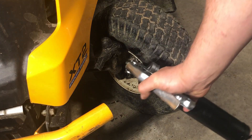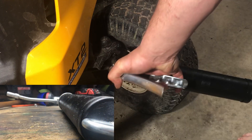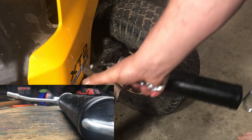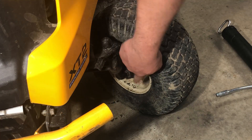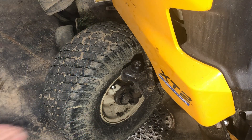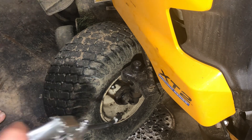You can really see how the slight bend in the grease gun tube makes it possible to get into hard-to-reach places to hit those zerks. Just keep pumping until grease comes out somewhere and you are done. Make sure you clean the zerk really well, otherwise you are pumping dirt inside your joint — not a good idea.